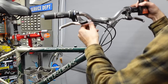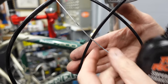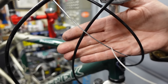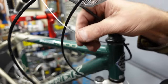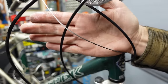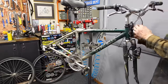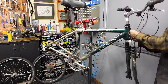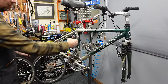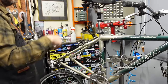I just did both of the shifters and the front. Here's the rear brake cable — this is something I noticed right away. Right in here you can see how there's kind of a white film, and if I rub it a little bit it turns darker. That's old dry lube. If you put the Tri-Flow on there it makes it dark — it's re-lubricated. It's just a nice visual aid. When it gets dried out inside the housing there's a lot more friction, and then the brakes don't feel snappy. I focus on where the housing goes. This back loop of the rear derailleur is probably where the most friction is, so really make sure you get that lubed.